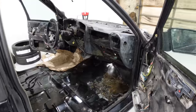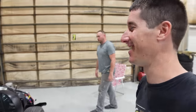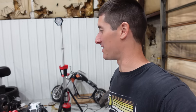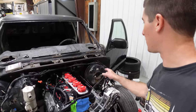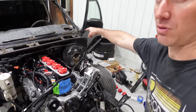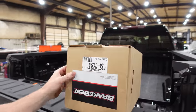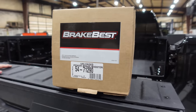Let's try to get this brake booster in. Wait — we have to paint the brake booster. The brake booster came as just standard stamped metal, and that is not okay for inside this truck. So we're going to paint that new one, and I'm going to get in here and get this one out. It takes a 17mm or 15mm for these four bolts inside in the cab. The part number on that booster is 54-71290 — that's exactly what you need to LS swap your S10 and make everything fit.